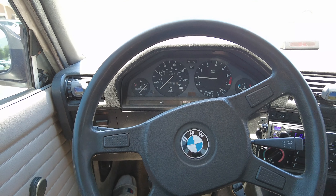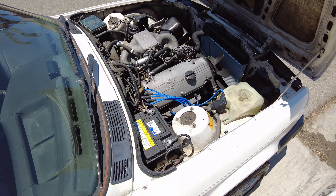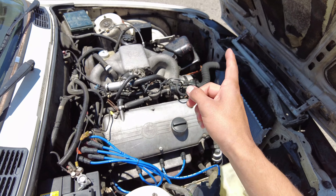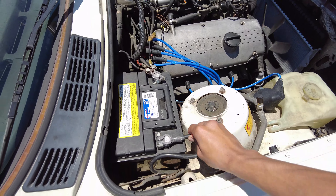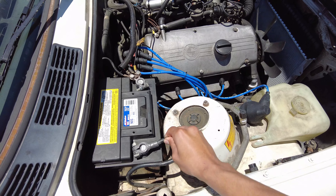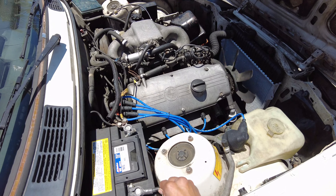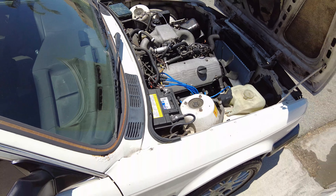That's because the starter is bad. If you want to know if your starter is going bad, you can leave your car running and do a test. What you can do to see if your starter or alternator is bad is take off the negative cable. If the car is still running, that means it's not your alternator, so there's a higher chance it is your starter.